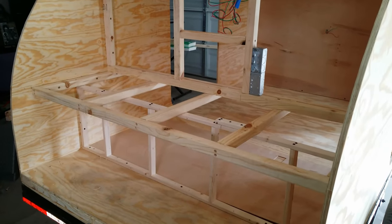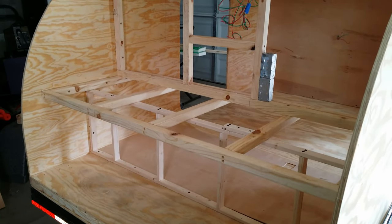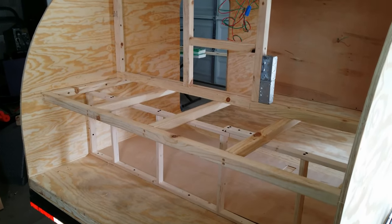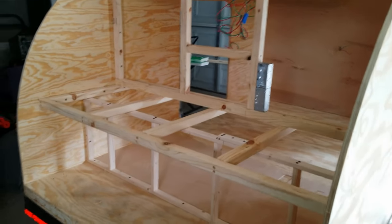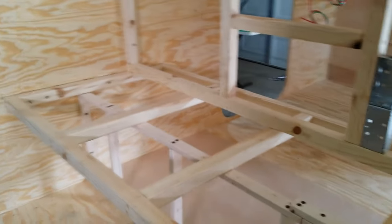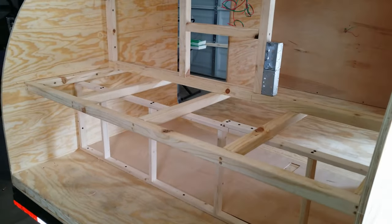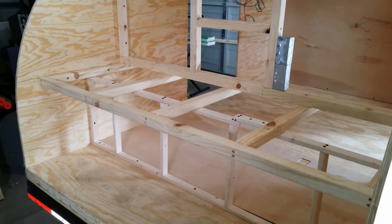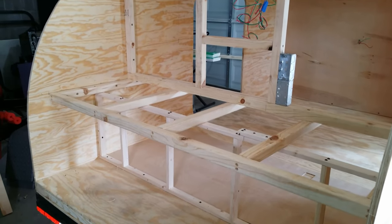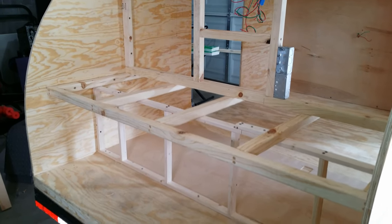You and I just camp a couple, two, three, even four times a year — usually some way more, and I understand that. But this camper is being built for somebody that's going to live in it. The reason why I'm doing the galley this way — as you can see, these are just like stick-built walls — is because we are going to insulate this back wall, and this is the easiest way to do that. Another reason we're doing it this way is for weight. This weighs a lot less than plywood would, and it also allows you to insulate in between the walls like you're supposed to.